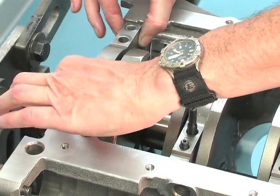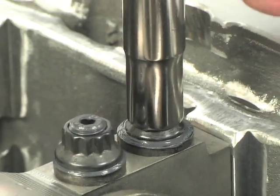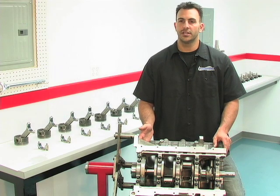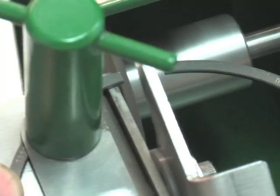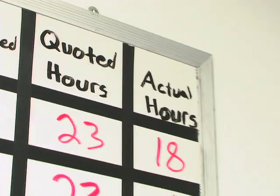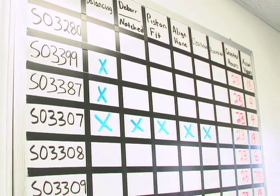After installing the main caps carefully over the crankshaft, we're ready for step two. We've completed final inspection for assembly — installed the main bearings, installed the crankshaft, measured crankshaft end play, assembled the rods and pistons, and file fit the rings. Next, we will start installing the pistons and torquing the rods. We're almost halfway through this 30-point inspection process with this engine build.